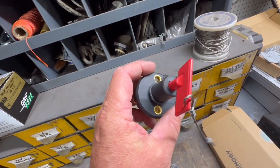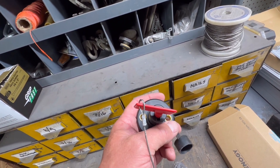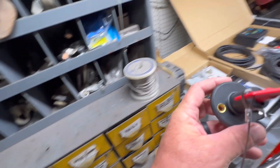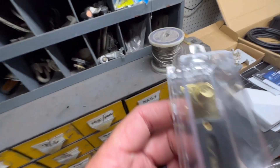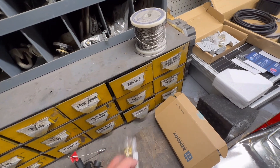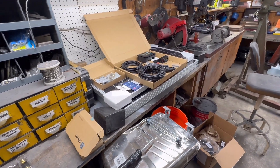What I added to the kit is a battery disconnect, which will go right next to my regular battery disconnect that disconnects the batteries from the coach. This will allow me to disconnect the panels from the charge controller if I don't want the system operating. I also have a 30-amp fuse that will go in-line between the charge controller and my batteries.